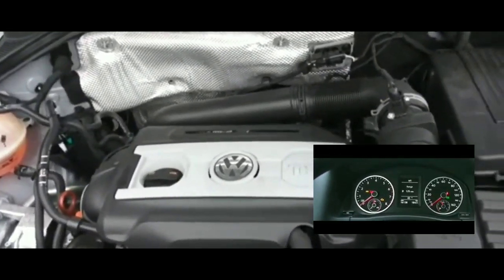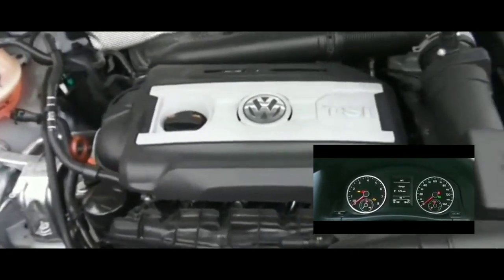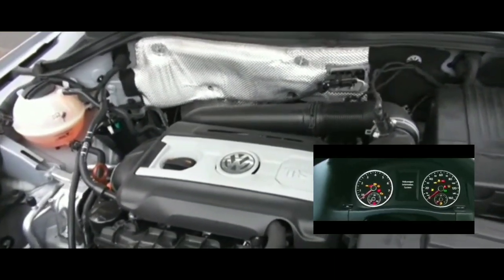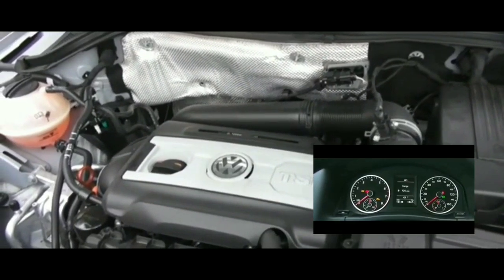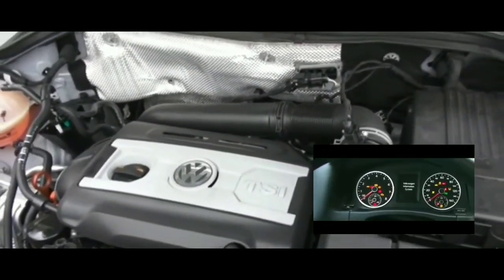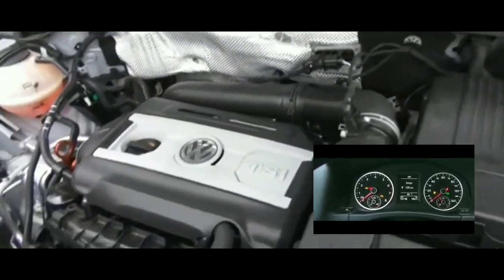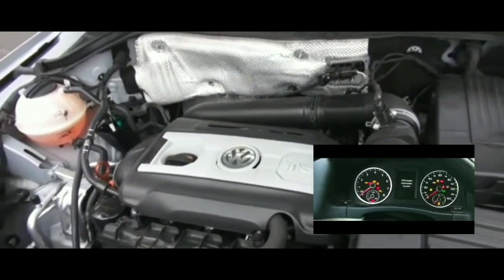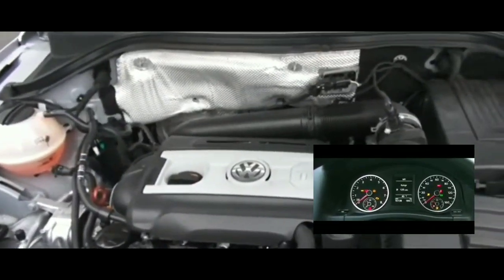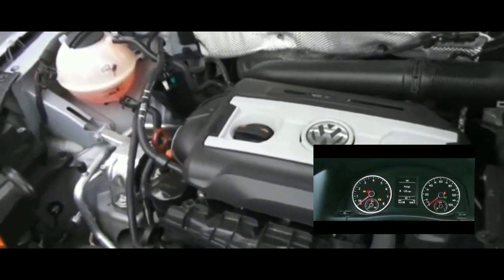In past fuse experiences, I had a Honda where the main fuse in the fuse box connects the battery — if that blows, you get zero power to the car, 100% dead. That's not the situation here because I have full power everywhere: power windows, everything. So I know it's not the main fuse.